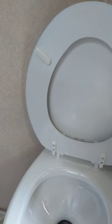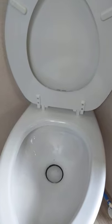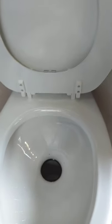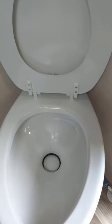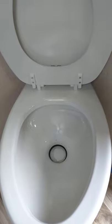Okay. Shower works like any other shower. The toilet, you have to remember, you have to put chemical in it, okay? So when you first get to the campground, you hook up your power, you hook up your water, and then you're going to come in here and you're going to dump your chemical right in here, whichever chemical you use. Then you'll step on this, because you have water hooked up, water will come swirling out and start to fill your black tank. You always put a gallon or two in the black tank to start off with. Each time you start fresh with the toilet. So if it's been dumped and you're going to use it again, you're going to use chemical and a little bit of water, okay?